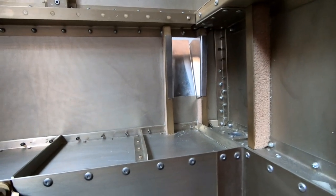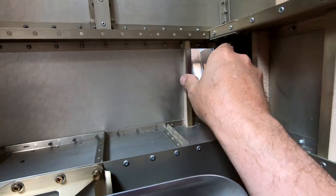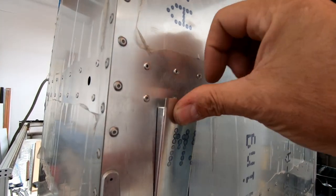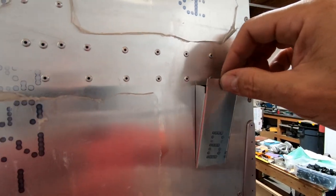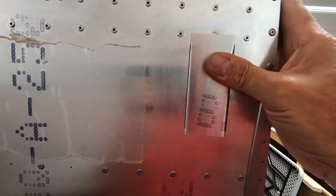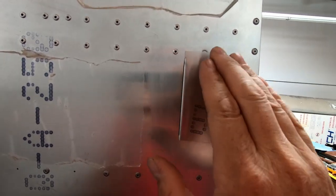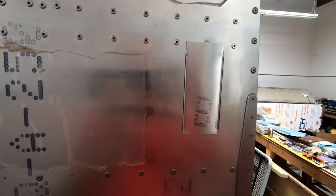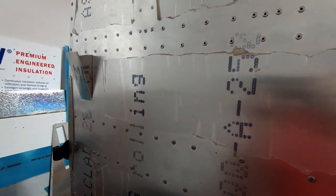Returning the next morning, the clamps were removed, excess glue cleaned up on both sides, and the vents popped in. They work well — no metal-to-metal contact, just sliding smoothly on the foam strips. The vent closes up nicely. The corners still need to be rounded and bent over slightly to prevent the vent from accidentally sliding up and popping out, though if it did come out it would only fall inside the cockpit.